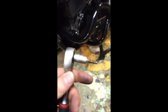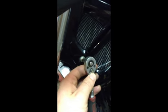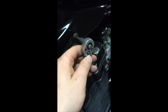Using a ratchet and an allen key, remove these two screws here. Once that cowl is removed, this will give you access to the spark plug caps — there's one here and there's one further on inside there.